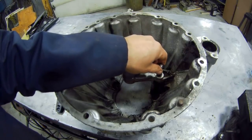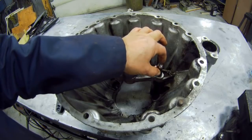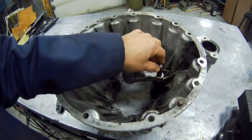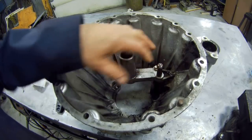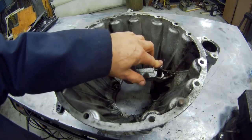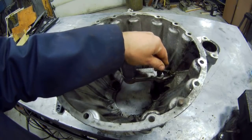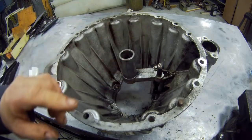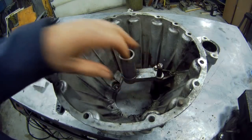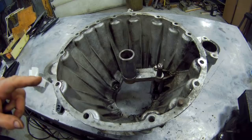One of the things to look for is this arm. See this ball — if it's loose like this and comes out, it's scrap. This whole section is scrap. I'll put it on just to show you what it's like, but that's no good at all. It should be a press fit, and the action of a clutch with friction has caused that.